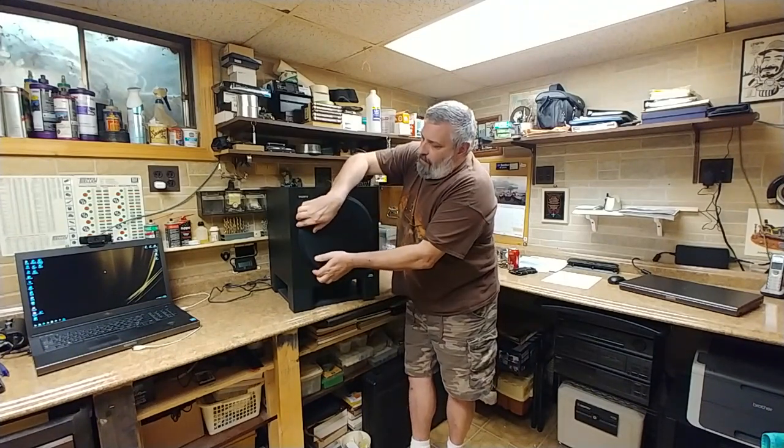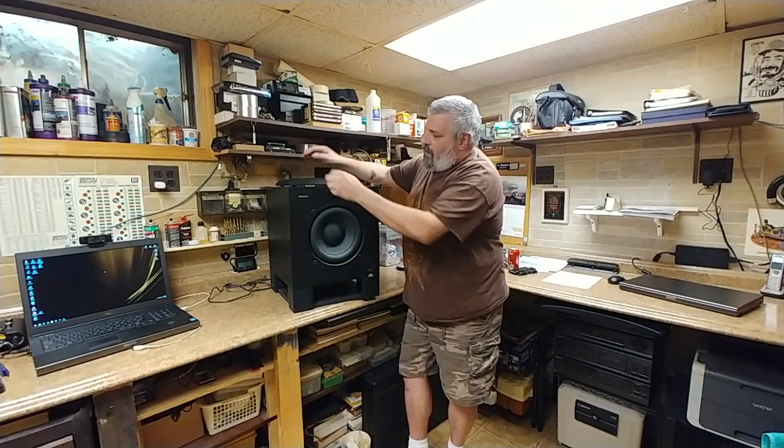So before I get into the nitty-gritty, again this is a Sony SA-WX700. This is a 250-watt digital amplifier inside of this thing. I'm not sure if that is RMS or peak — they just say 250 watts. This has got dual 10-inch long-throw subwoofers, one facing forward and one upside down in the bottom. When I say long-throw subwoofer, it has a very beefy surround, the extension is a lot better than normal subwoofers, and you can get better frequencies out of it. Frequency response is 20 Hz to 200 Hz.